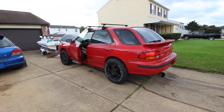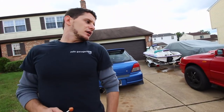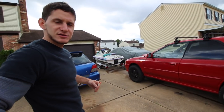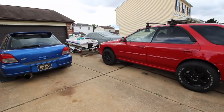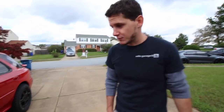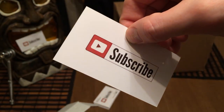If we really wanted to, we could totally set it up like this while we're in the parking lot at an event and then take it all apart. But if you want to go lifted with big tires that are spaced out, you need to cut your fenders — that'll solve all your problems. It's either that or go a little bit smaller with the wheels and tire fitment. That's the answer to how they ride.